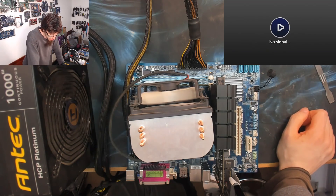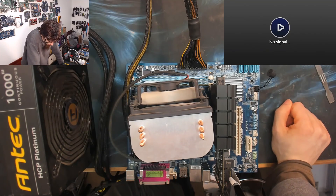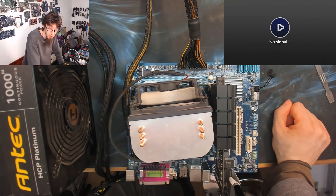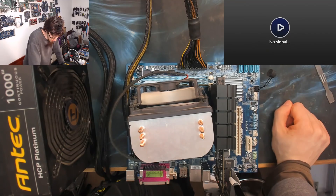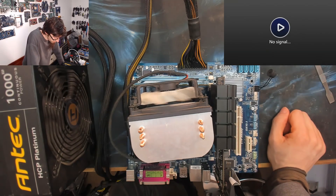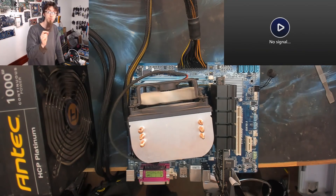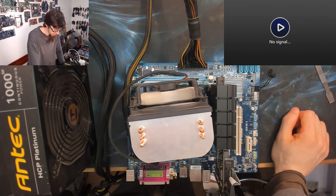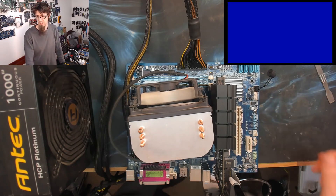What's going through my mind at the moment is that it looks like we've got a bad motherboard, and I'm tempted to get out my BIOS programmer and reflash the BIOS chips, just to see if maybe it's a corrupted BIOS or something like that. This is a Gigabyte motherboard — it's supposed to have dual BIOS, however we have seen in the past that Gigabyte's dual BIOS, unless you have a physical switch allowing you to select the BIOS, just doesn't seem to be worth anything.